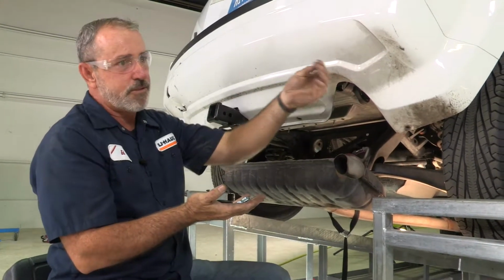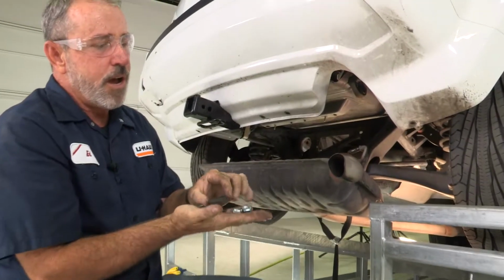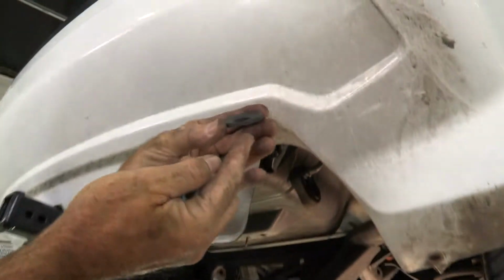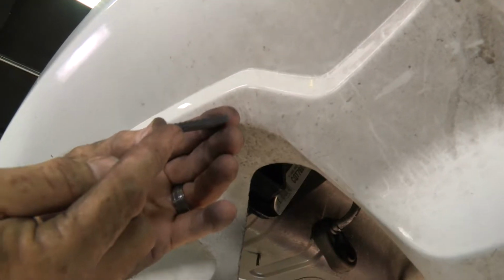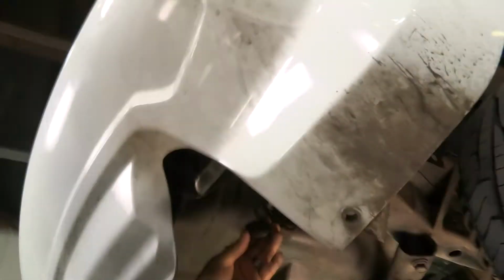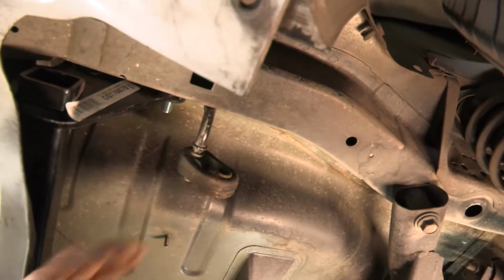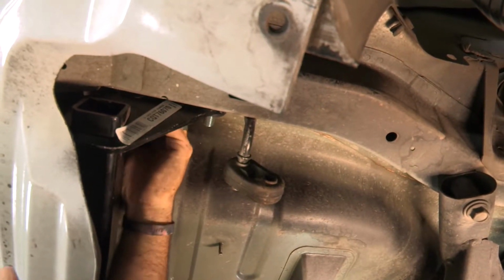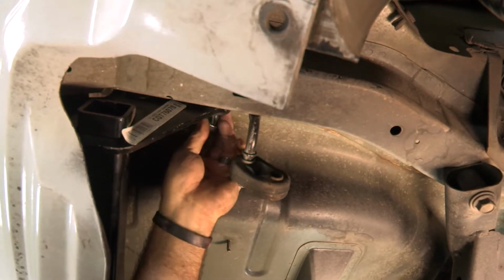We have our bolts through the frame and then through the hitch. Now we just need to put our hardware through. We're going to start with the conical teeth washer. You can see that it has teeth that will contact the hitch for gripping purposes. We'll go ahead and start putting these on first. Slides right over the bolt. Get our most rear one here. We'll go ahead and screw the nuts onto the bolt.